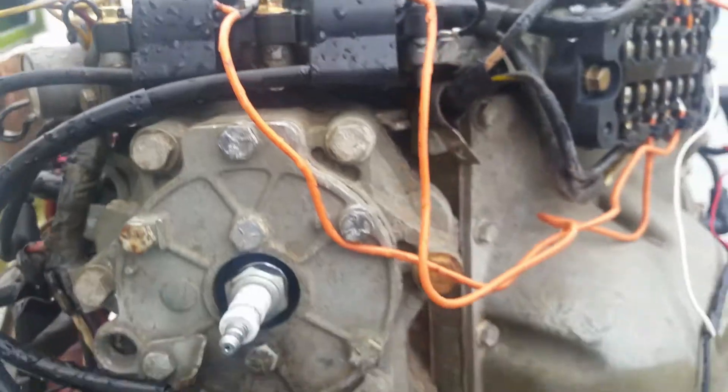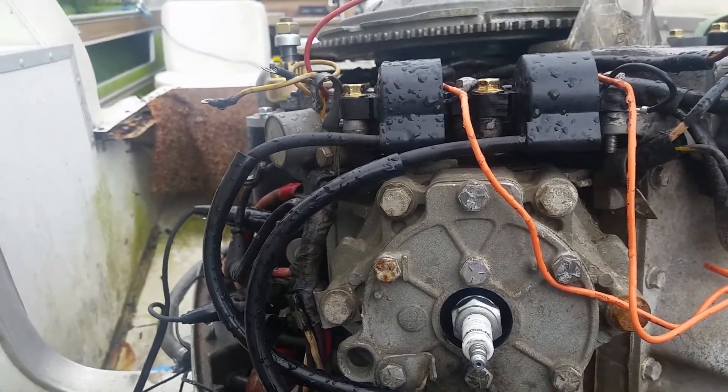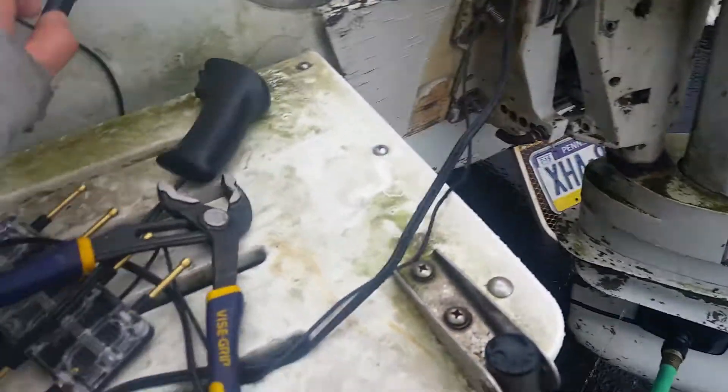There's sparking there between the ground on the coils - I guess that was from the spark plug boot in the back of the coil. That's where the arcing was happening. So let's hook up our spark tester.